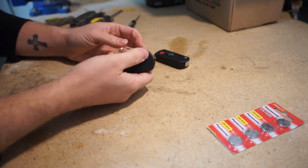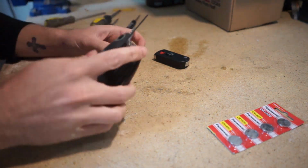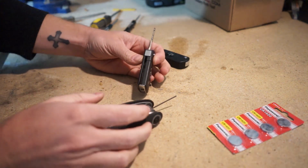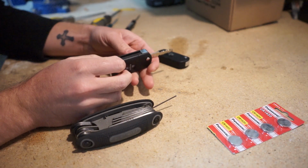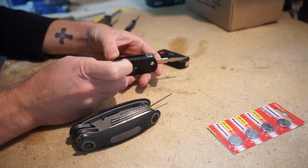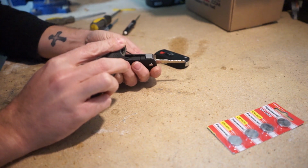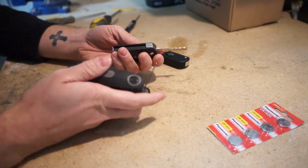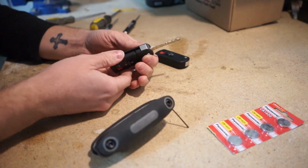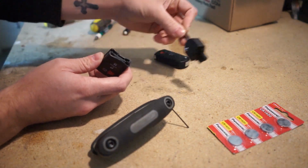You want to take your key and open up the switchblade key portion of it. And I'm using this little Allen to get to the inside part. Inside the key is this little tab in there, and it's kind of hard to see, but there's a clear little break where it almost looks like a little hook tab kind of thing. And you'll see it in the close-ups, but what you'll do, you'll take your whatever thing you want to use. You can use a paper clip too. You push it in, press it down. As you can see, the key separates just like that. So this will be the top part of your key. You don't need this part, you can set it aside.